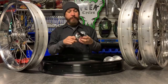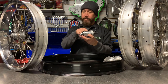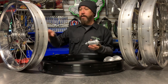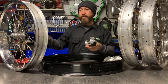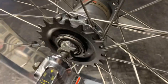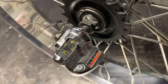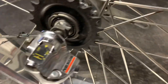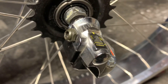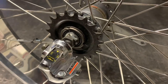A couple more things about the Sturmey Archer hub: one, it's set up for coaster brakes, which is nice if you don't want to deal with disc brakes. Secondly, the dropout spacing — both the Sturmey Archer and the Nexus 3 are set up for pretty much most over-the-counter frames. This one is at 116 millimeters wide, whereas the Nexus 3 is 120 millimeters wide. Not much difference, and again both hubs should slide into most over-the-counter frames. Now, the Nexus 3 has a shifter bell housing that mounts to the outside of your dropout. That allen screw is how you tighten it down — you can strip it out by over-tightening, so go hand-tight with your allen, be gentle, and it'll hold.